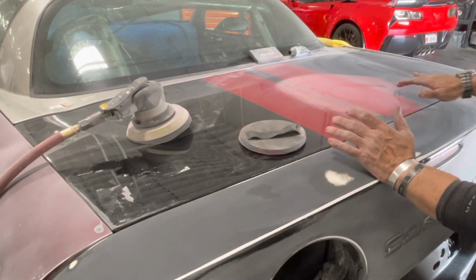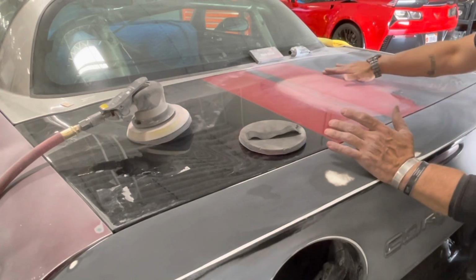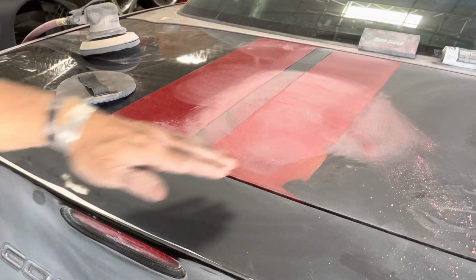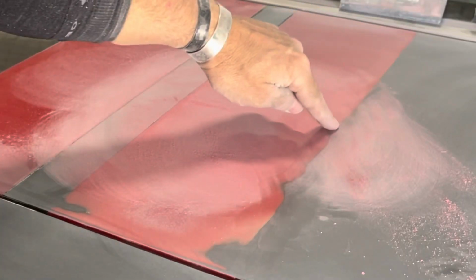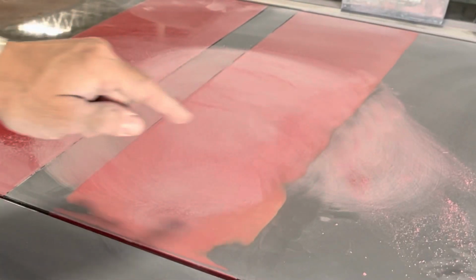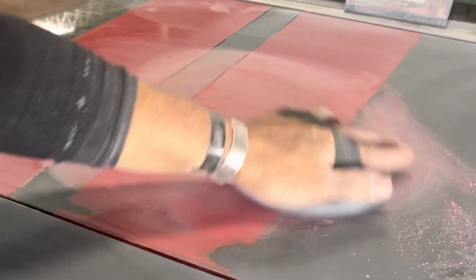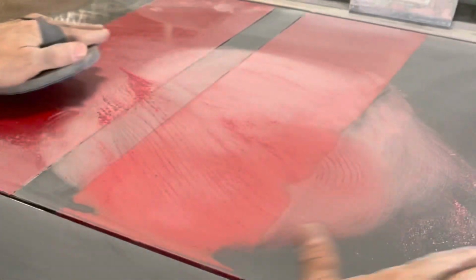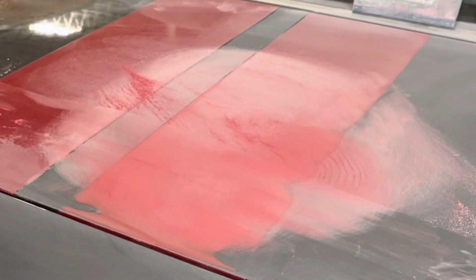What you want to do is make it thin enough that it feather edges all the way along, and I'll bring the camera over and show you just that. So you want this just to feather edge, where the edge of it almost looks jagged, like a bread knife. And that tells you that you've got the paint thin enough through there that you're starting to wear away at that paint. Basically, you're just going to get a nice smooth transition from there all the way over.